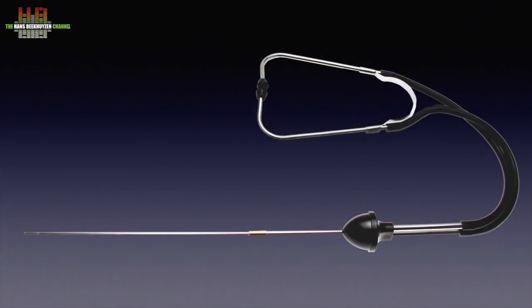Whatever accessory you use to decouple your equipment and place your speakers on, remember that using only 3 feet will give a very sturdy placement. In the case of speakers, keep in mind that they might tip over easily with only 3 feet. If you are not sure about resonances in your system, search for 'Mechanics Stethoscope' on Amazon — for under 20 dollars you can get one, simply hold it to the part you expect to resonate, and you will hear the resonances if present. Now, there will be people who disagree with the information in this video, and that's okay. In audio there will always be circumstances that don't work with general rules — not because of voodoo, but simply since we don't understand everything in audio. That makes audio so much fun to report on.